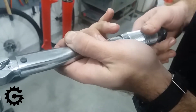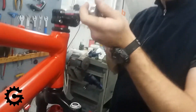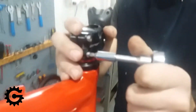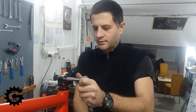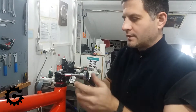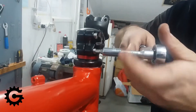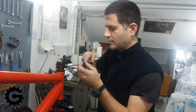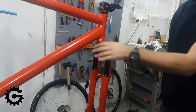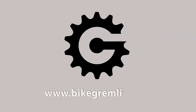I am setting the torque wrench to 5 Nm. If using anti-seize or some other mounting paste or grease on the bolts — which is recommended — it is usually needed to set the tightening torque about 20% lower than the specified torque for dry mounts. Most manufacturers will explicitly say the recommended torque is for dry mounting, but if it is not stated you can conclude it is for dry mounting and reduce the torque by about 20%. So in this case it will be just over 4 Nm. Here I am using the torque wrench properly, holding it at the end. The first movements were just to build up speed because I was nowhere near the recommended torque. In the next video we will show the other parts of bicycle assembly. Thanks for watching.